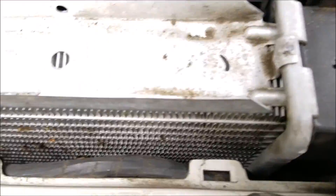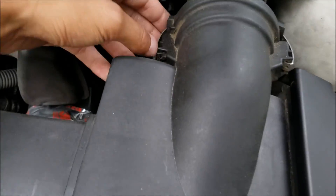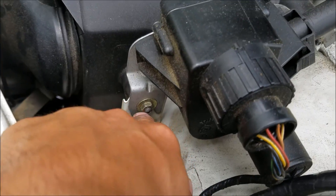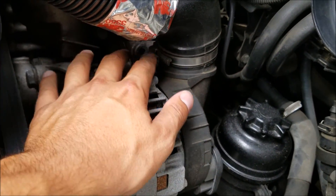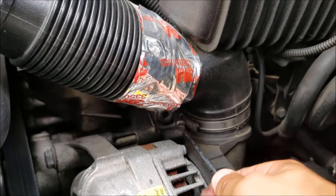The next step is to get your alternator air duct out of the way. First thing you've got to do is pull your air box. It's real simple — I'm going to remove it at the mass airflow sensor. You just have these two clips that you can pull with your fingers; I don't even use a screwdriver. Then you've got these two 10mm bolts right here and then this pops right out. Once the air box is out, remove this hose — you just have one hose clamp right here. It's just a flat head and it won't be on very tight.